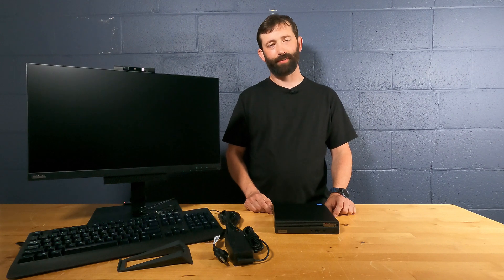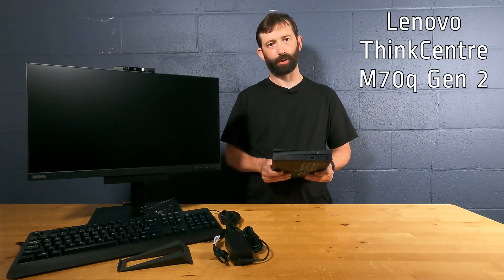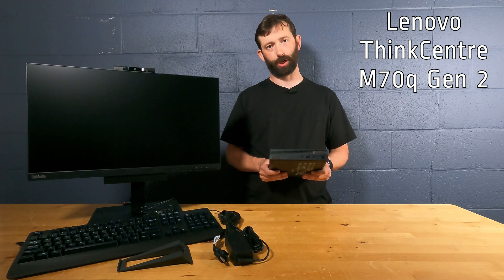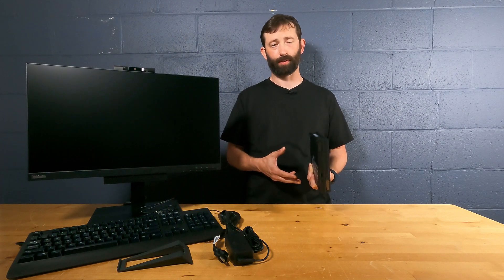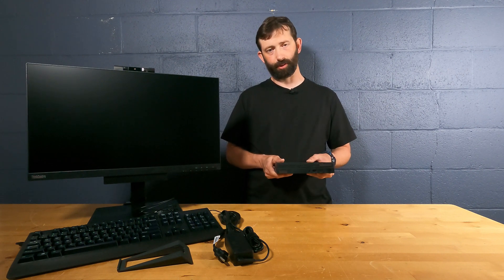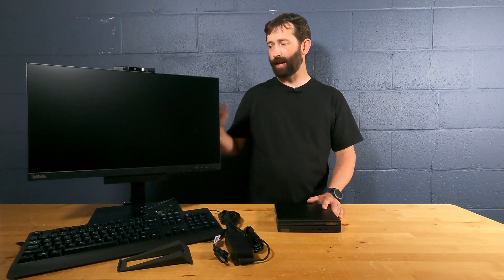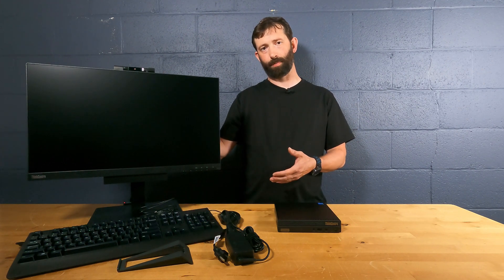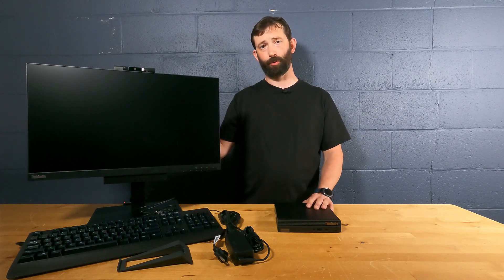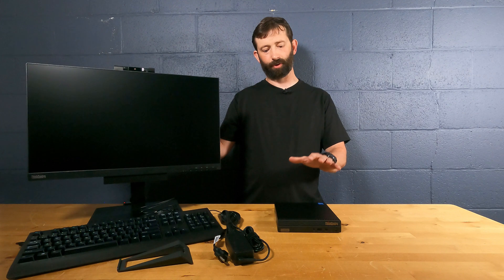Hey guys, thank you so much for watching. If you haven't subscribed to our channel yet, we'd really appreciate it if you would. Today we're going to take a look at a Lenovo Tiny ThinkCenter PC, the M70Q Gen2. This one's powered by Intel. I really like these tinies because they're very compact but you can open them up and actually access things inside. The RAM is removable, you can throw a 2.5-inch drive in them, and this came with an NVMe SSD that's quite fast. It includes a power adapter and a wired keyboard and mouse, as well as a little stand. It does not include a monitor, but it's really neat if you pair it with a Tiny-in-One monitor — it'll actually slide into the back and you can kind of make your own all-in-one. I'll link that in the description. We're going to go over the specs, the outside and inside, and benchmarks as well.